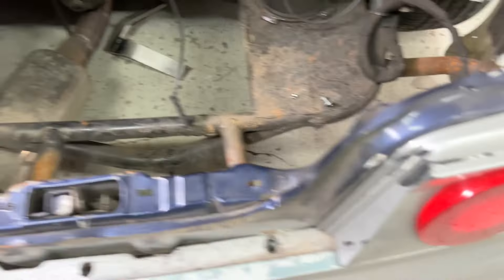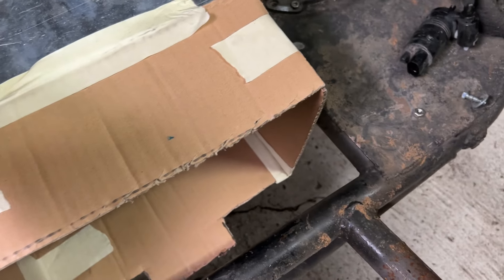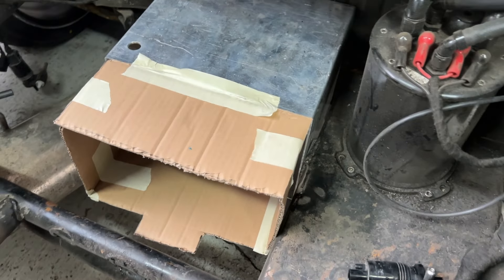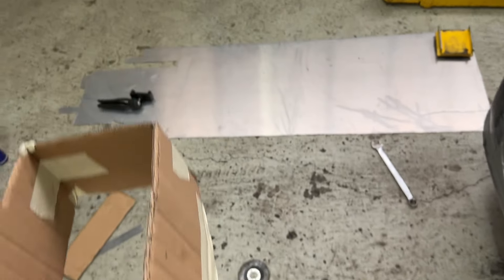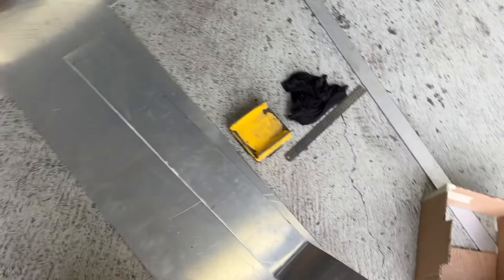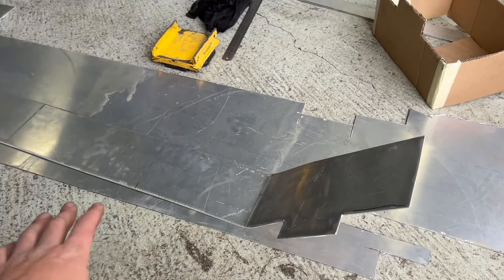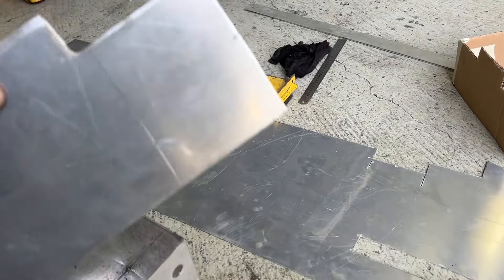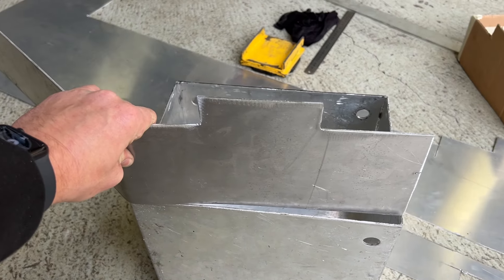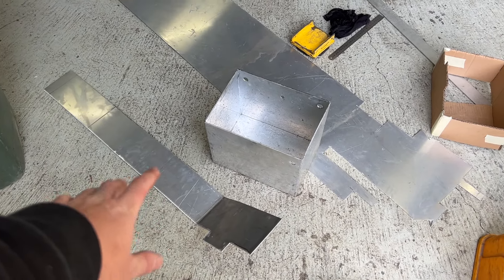Look at all this space we have now — I've cut all the brackets off and that's as much room as I can really get, so I'm going to start converting these into alloy sheet. I've got my little template made up, but I have no actual proper bender for this sheet metal. I'm actually going to tack it in place and bend it as I go — I think that'll give us the best way of getting this bent to where we need to be.